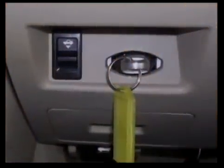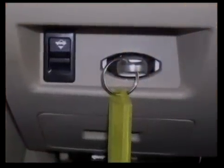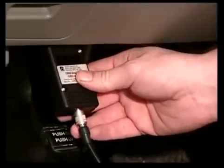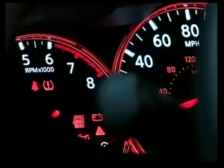Prior to plugging the vehicle in, place the key in the on position with the engine off. Use the OBD connector to plug the Tech 400 into the OBD port underneath the dashboard. As the data is being sent to the car, the warning light will likely continue to flash. Once the IDs are successfully written to the car, the light should go off.